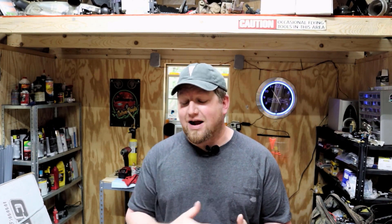First of all, I know we're talking largely about engines here, but some of the best bang-for-the-buck early mods don't have anything to do with the engine at all. The reason is that 3800s are pretty good engines right out of the gate. However, they're very often under-maintained, so if you're looking at modifying your car, the very first thing you should do is maintenance — fix any old fluids, leaks, whatever needs to be fixed. Don't spend money on mods when the car has things actually wrong with it.